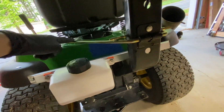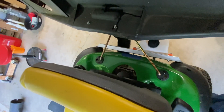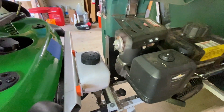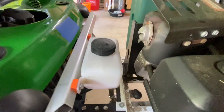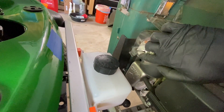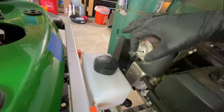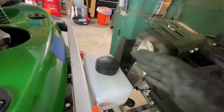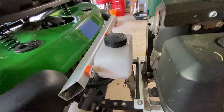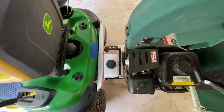I thought I did a good job selecting the mounting point for the tank, but I made the mistake of not test fitting all of my mower attachments. I have a cyclone rake leaf vacuum that I tow behind the mower in the fall to clean up leaves. What I discovered is that the exhaust for the cyclone rake is right next to my expansion tank. You can see that the exhaust port directs the exhaust right onto the tank. I tried turning the port so that it would direct the exhaust away from the tank, but this whole area still got super hot. It got so hot that the plastic tank started to deform from the heat. My only choice is to relocate the tank.